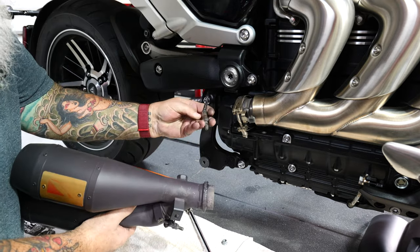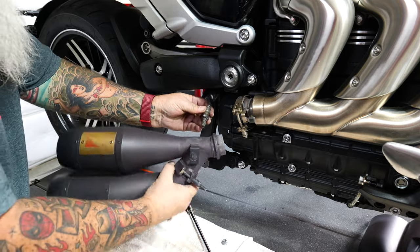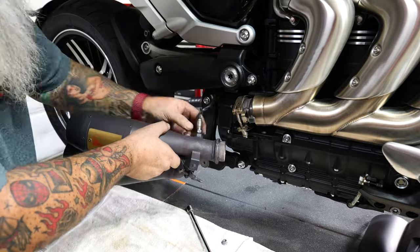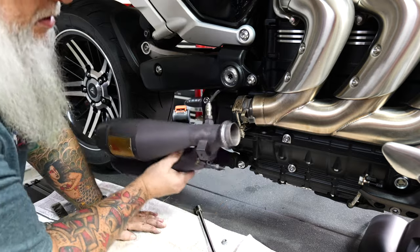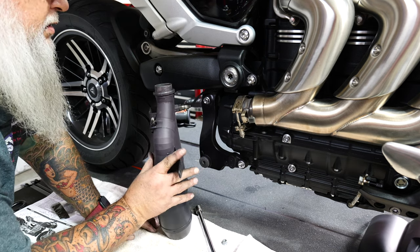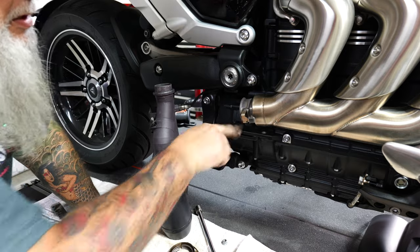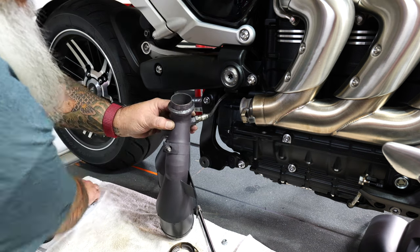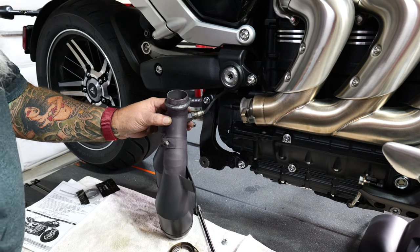So now you're just dealing with this — so much easier, so much lighter. We're going to twist this up a little bit so that when we're done it's not as kinked as it was before when you're trying to wind it in. And we'll attach this in. It doesn't have to be super, super tight — just got to be in there. So now the O2 sensor is connected. Now feeling in here, there's no gasket. So on new WORX pipes you're not going to have this gasket in here — that's where this guy would go and slide over on there. But because I already have one in there, I can just use the same thing.